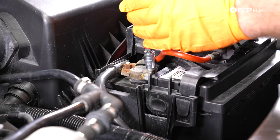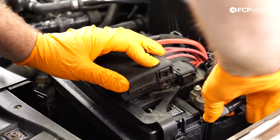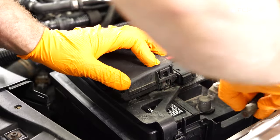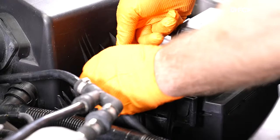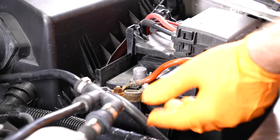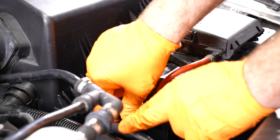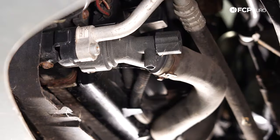These are going to be two 10mm nuts here. We're just going to loosen those — start the negative first and just twist and work it off. Same thing with the positive. You could technically leave the positive on and just disconnect the negative, but with these cables you can see they naturally have memory to go back to where they were, so it's just better to disconnect both. A little backstory on this car — it's been sitting for quite a while and the coolant bottle is currently empty. So I'm going to show you where to drain the coolant from. This is the lower hose and you can see there's this little petcock — you're just going to want to turn this to the left and let that drain.